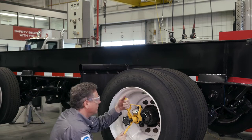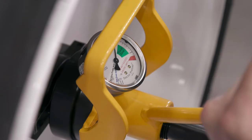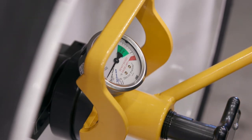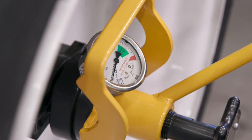To set the bearings, loosen the T-handle, turning it counterclockwise slowly until the needle pointer reaches the thousand pounds force hash mark. Keep in mind not to go past the set point. If the set point is overshot, go back to the beginning of the bearing adjustment procedure to seat the bearing rollers.